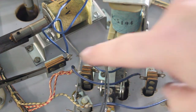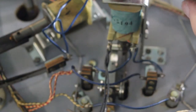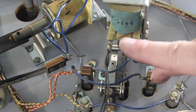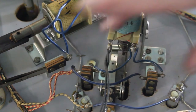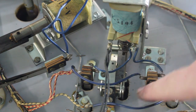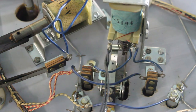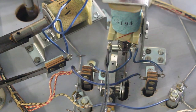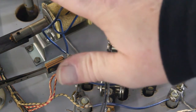But these contacts have to do two things. Turn the coil on and give you the 100 points. That's why it's instantaneous, because these ones do it at the same time. As soon as you hit it, 100 points, and it's kicking barely before the scoring reel even knows what it's supposed to do. It's that quick that it turns that coil on. So a little more on what coils do.